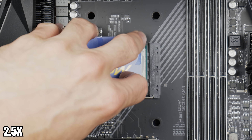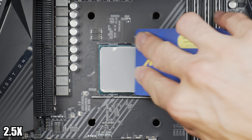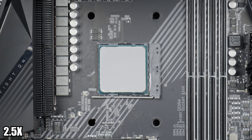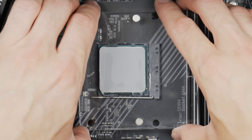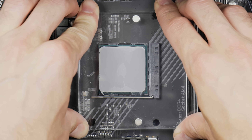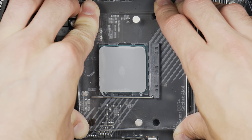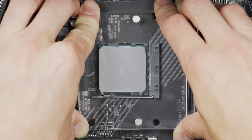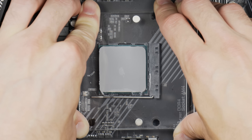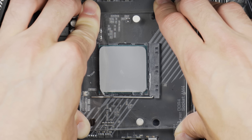And now for the famous buttered toast spread method — I used a plastic card to get a decent spread. Not a bad job, but as I apply pressure on the CPU we can see an air pocket form in the center. It eventually disappears, but where did it go? Did it escape or is it just lingering in there? It's hard to tell. The coverage otherwise is great — obviously, since you spread it over the entire IHS, it better be good, except for that little tiny spot in the bottom.